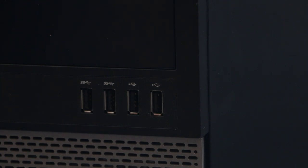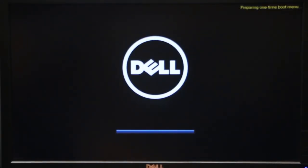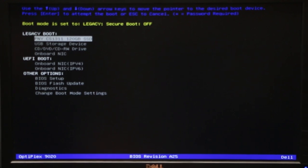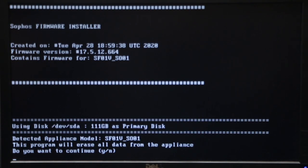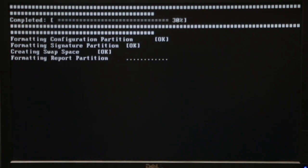Once this process is complete, click Close and eject the flash drive. Now plug in your flash drive into your computer. Start your computer and at startup you'll have to boot into the boot menu — on my computer it's F12, on yours it could be something else. In here I'm gonna choose USB Storage Device and press Enter. At this screen I'm just gonna press Y and press Enter. This is basically stating everything is gonna be deleted from my hard drive and it's gonna be overwritten with a new OS. Now we just have to wait until it installs Sophos firewall router on our PC.